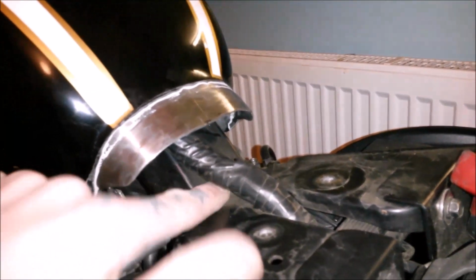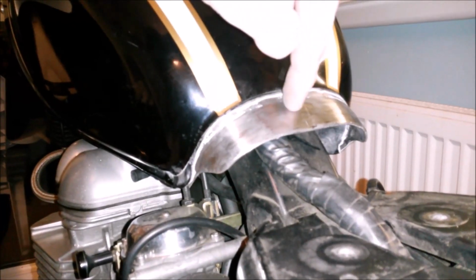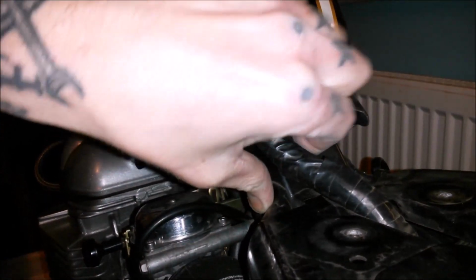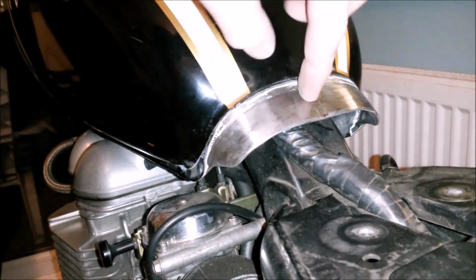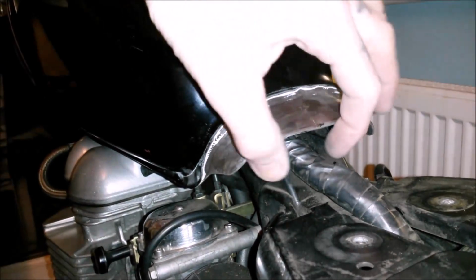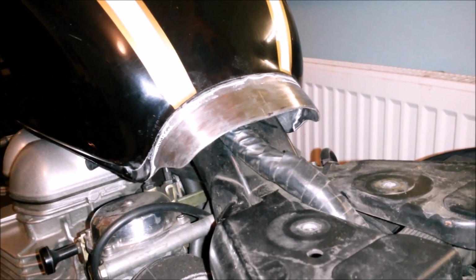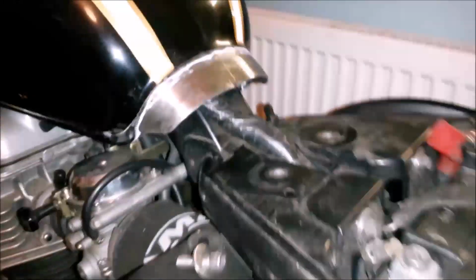So just looking at possible options here, one is to clean the bike, obviously. The other one is I could just drill a hole through here, make a sort of standoff, have the wiring pushed just to one side, but have a little standoff here and a captive nut drilled into the spine of the tank and just boom, straight away bolted on, and then maybe a little piece of metal across here just to hold the seat on. So that'd be quite quick and easy, but I would like to try and do it using the existing kind of stock mounting arrangement as close as I can.